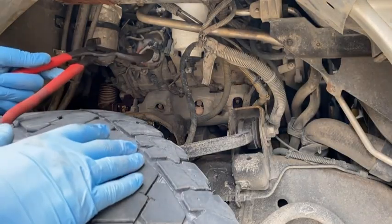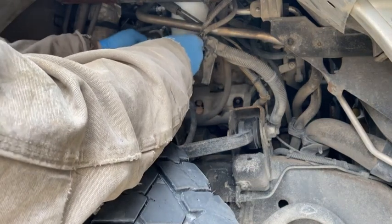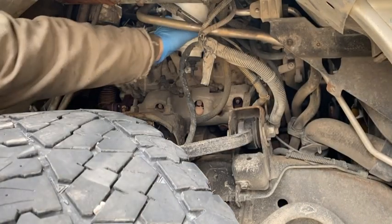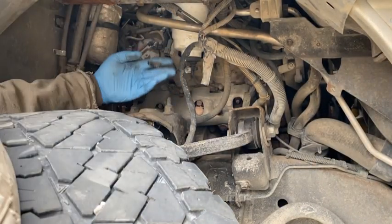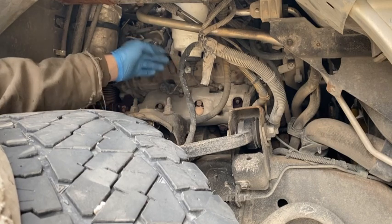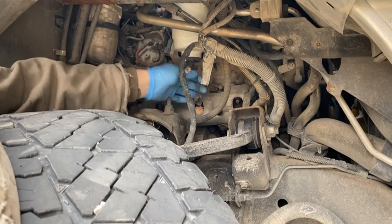Now, when you snatch this out of here, I want you to remember two things. Don't tear up your water separator because it's made out of plastic on the bottom. And this is going to be full of diesel fuel. Don't forget to unplug the connector, because if you don't unplug that, as you're spinning this, it'll pull the wires out. It's a big fat headache, so you don't want to deal with that.